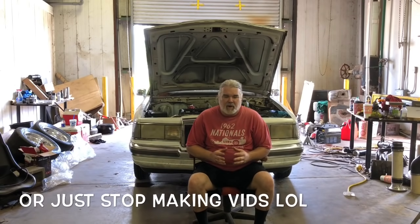Okay, now you know, baby. We got the power. But that's not all we're going to do. You can't just put an HO cam in this thing because it has the standard 302 firing order, and that will make the computer go, what are you doing here? It also has the 14-pound gray tops, which kind of stink. We also put a good fuel pump in it. I forgot about that. Maybe I should make a list, or cue cards. So we're going to put a cam in it, but that's not all.